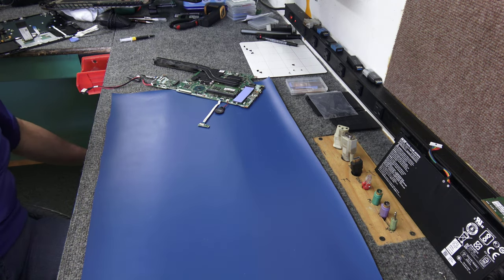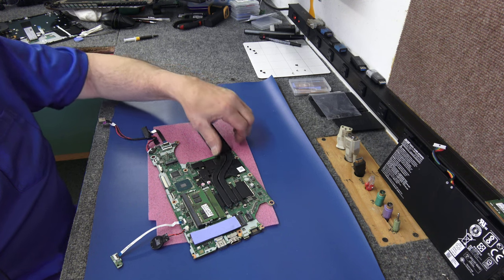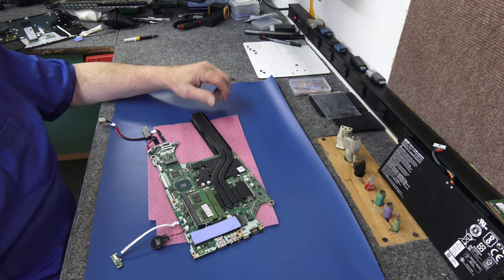I'm going to pause here real quick and go do a little more cleaning. I cleaned off all that tape that was covered and stuck up with goo and fuzz and lint. I'm just going to seal that up with some tape when all is said and done. Right now I've got to pull the heat sinks off the CPU and GPU here. Using a number zero Phillips screwdriver - just be very careful on your motherboard so you don't slip. I'll set these over here; they should all be the same. Never know how hard these are going to come off or what shape the thermal paste compound is going to be in underneath.